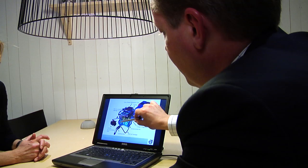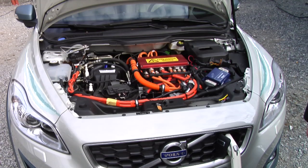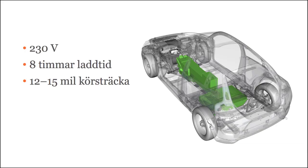This is the electric motor. These here are the front axle and the front wheels. Here we see the reduction gear beside the electric motor that cuts the electric motor speed of about 15,000 revs down to a more manageable 1,800 or 2,000 revs at the wheels. The car has just one single forward gear, and that's one of the reasons why top speed has been limited to 130 km per hour.